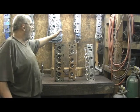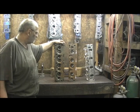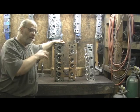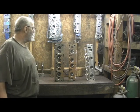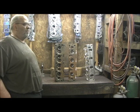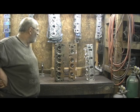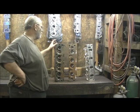I'm going to try to revive these things and save them — I had to give it my best shot. This is going to be a welding job and putting meat back in some of the bowls where it looks like he ground on them. We're going to do everything we can to save them, put some meat back in there, then reset the valve job and try to reshape it.